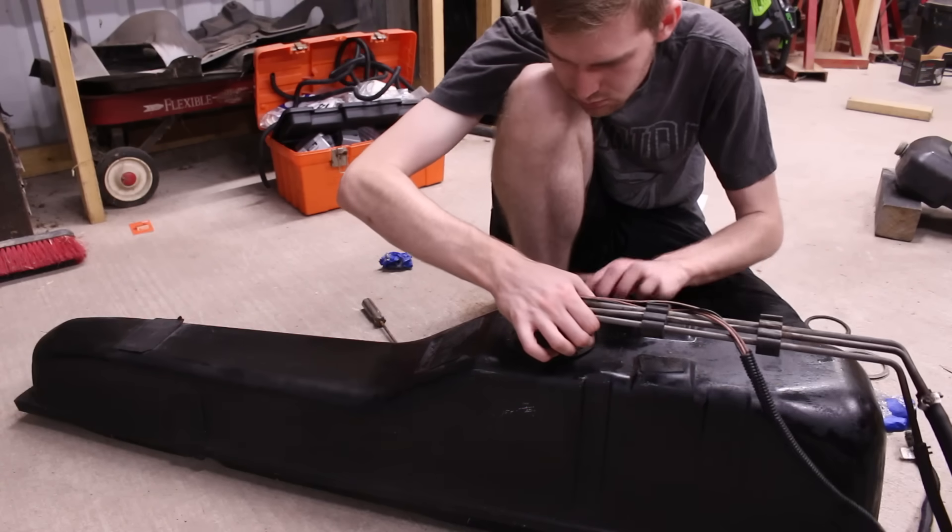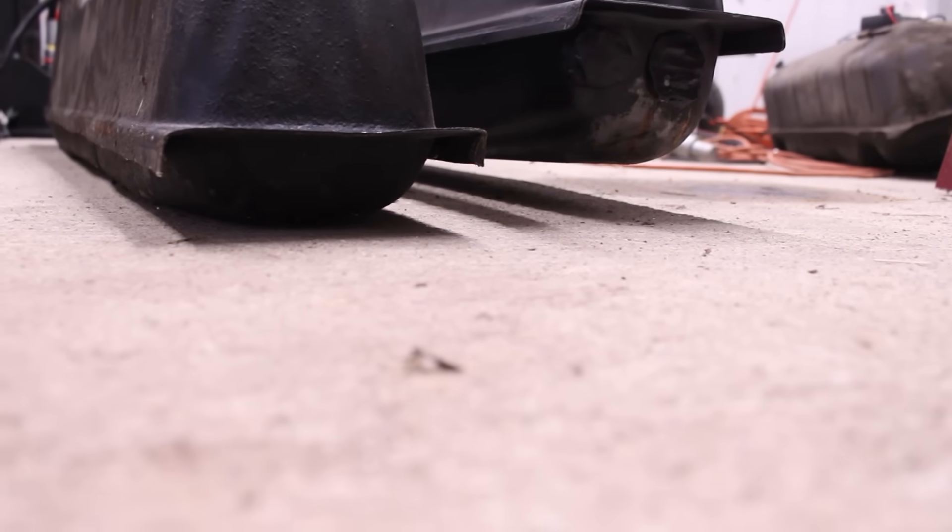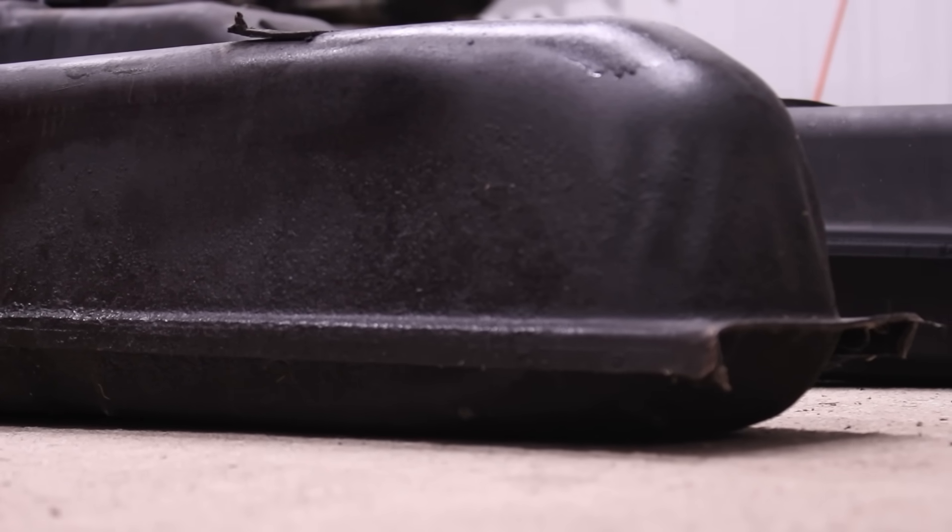I knew going in that I purchased a newer model Fiero gas tank, but I didn't realize it's not exactly compatible. The front section is physically taller than the older model tanks, so I'd need longer straps. On top of that, the 87 and 88 model gas tanks require a separate expansion tank, which I don't have, and the tank physically can't fit due to the lower seam hitting the brackets that hold the coolant lines down. It's probably best to just sell this tank and buy another older tank like I originally had, but rust-free.